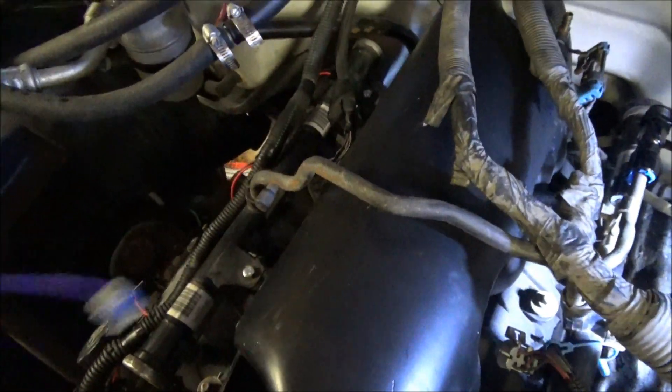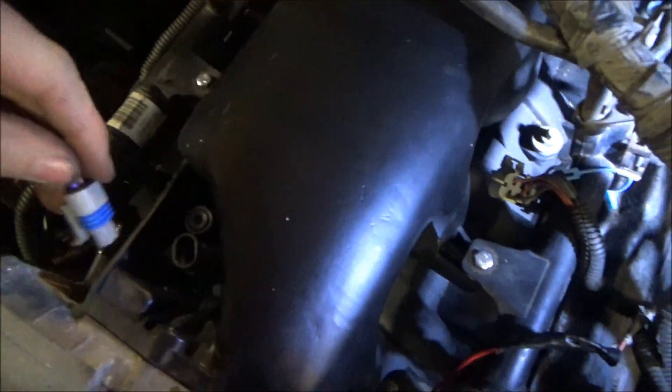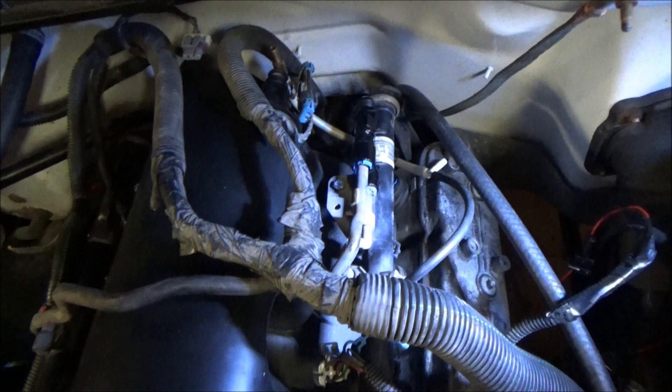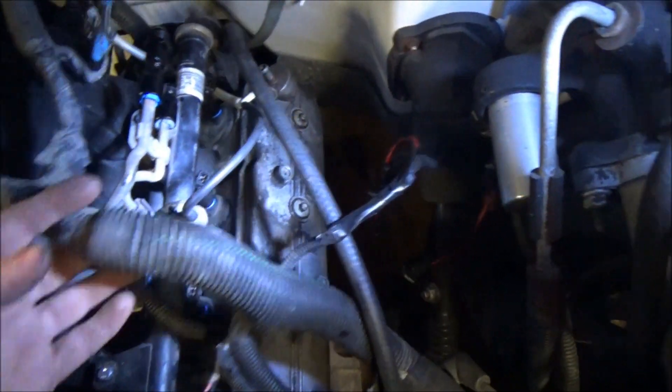IAT sensor pigtail is done — extended it out so it'll plug right in here into the top of the intake just like this. Mass airflow meter is deleted. Now we're on what's called a speed density setup — no mass airflow meter. The pigtails are all done over here for the injectors and laid out.